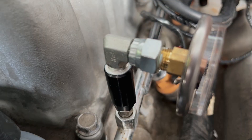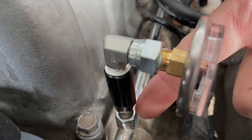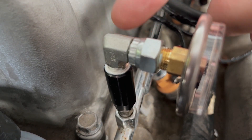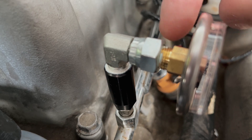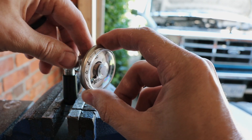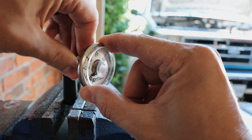Like, that's it — there's nothing else to it. And since it's got an O-ring buried in there, you don't have to use any kind of sealant or Teflon tape on the rail fitting, but I do recommend some sort of sealant on the gauge to 90 and the 90 to the adapter. While it might seem weird that there's three separate pieces here, having these extra fittings actually works really well to clock the gauge so it's easy to read.